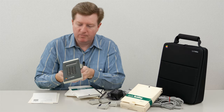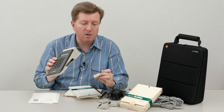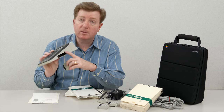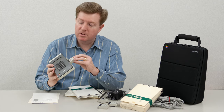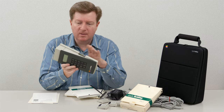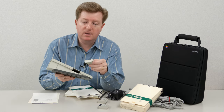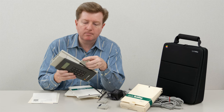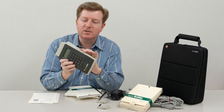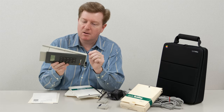So I'll insert this back in. Basically, what you would do is put in your ROM pack. These are marked A and B, so I'll put the CPU tests in A - it doesn't matter which slot - and then I'll put the SCSI hard drive tests in B. The manual says don't force it in, be careful. So they are properly installed.